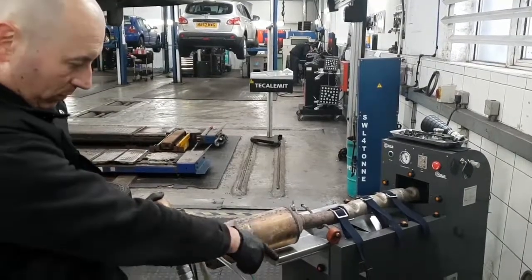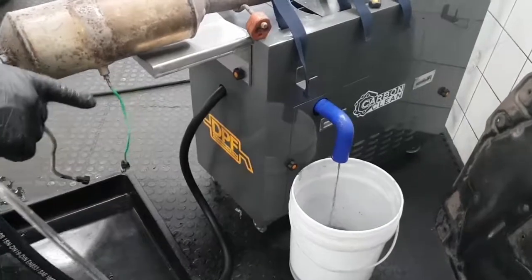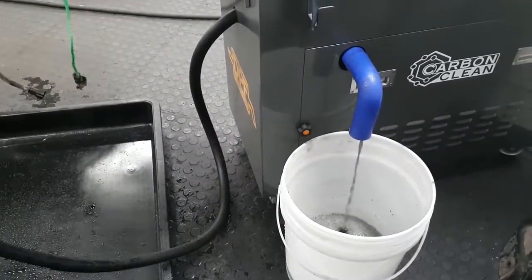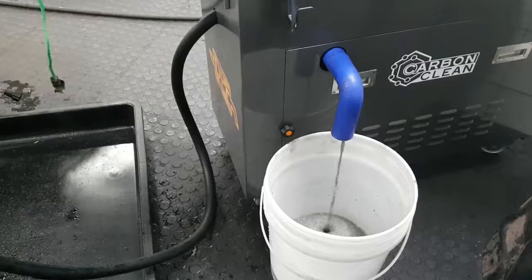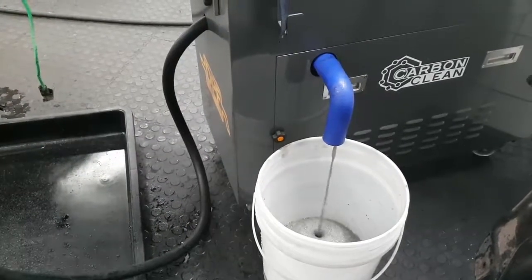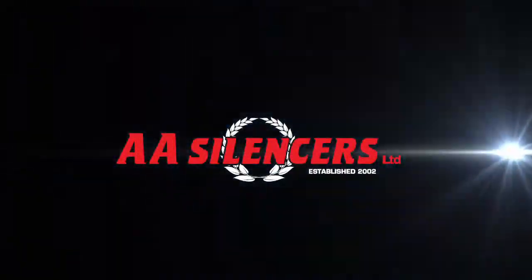As you can see now, we're just starting to get a trickle through. We've just managed to bring enough through the DPF to start forcing the fluid and water out. That will be black as black can be by the time we're done. This process realistically can take anything up to an hour. We'll see you later.